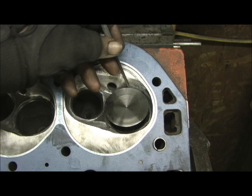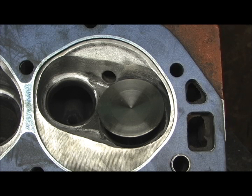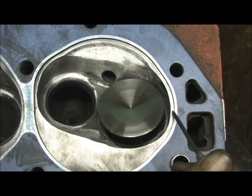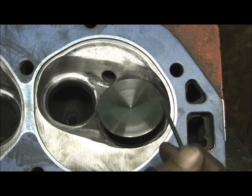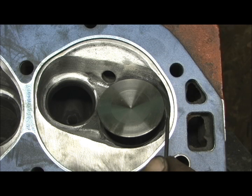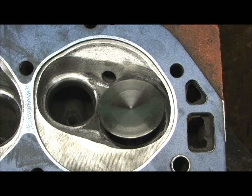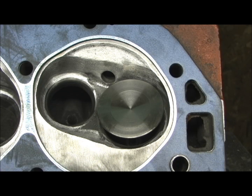While I do majorly unshroud it, I don't unshroud it as much and bring that gasket all the way over to the gasket line. Remember, it ain't just how much you unshroud — it's that you do it in a way where the combustion chamber lines up with the cylinder bore so that turbulent eddies ain't smashing into the block. It'll hit the valve notches and flow right into the bore, and I will put more air into the cylinder by doing this than if I went in and cut all that out thinking I've done something. Just that little mod I wanted to show you on the Stage 4 396 with the 2.19 and 1.88 valve.